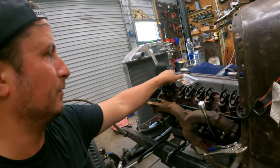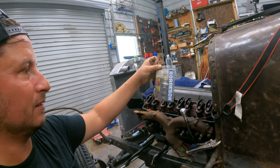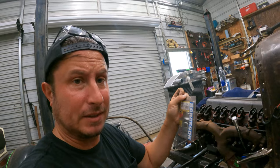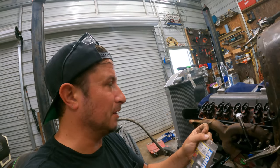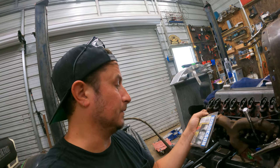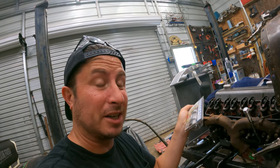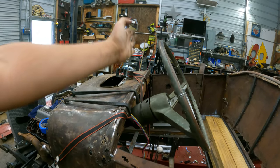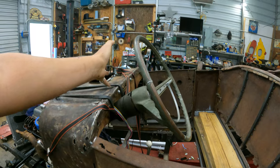Let's put some, I have these laying around for some reason. 3/4-inch bore, which is correct, aluminum U-joints. Certainly not something I purchased, but maybe in a move somewhere, somebody just threw them my way. So I don't know if we'll use them, but we can use them for mock-up right now. When you're setting up your steering on a Model T, just be careful that your windshield's right here, so you need enough room for your knuckles.